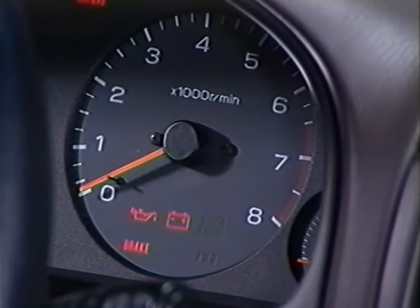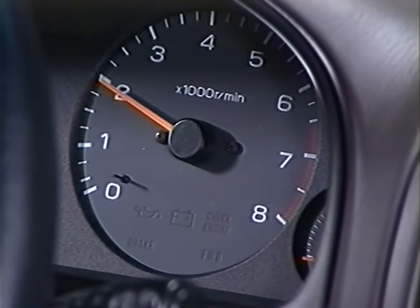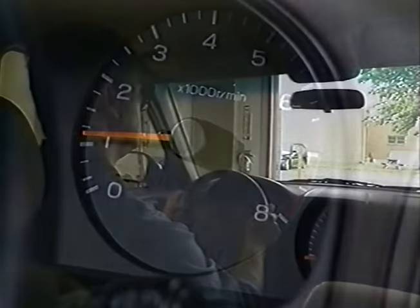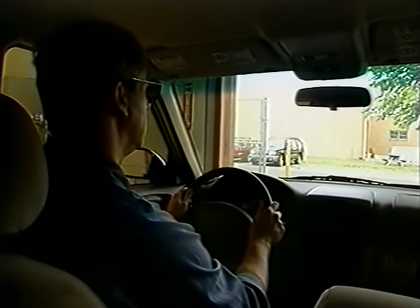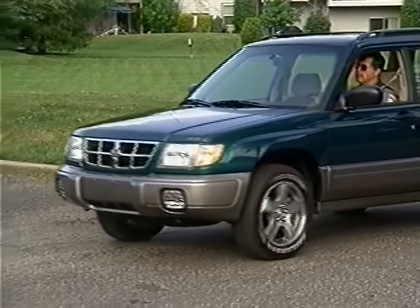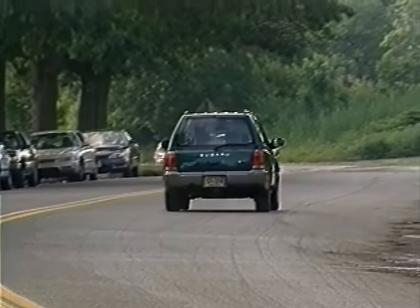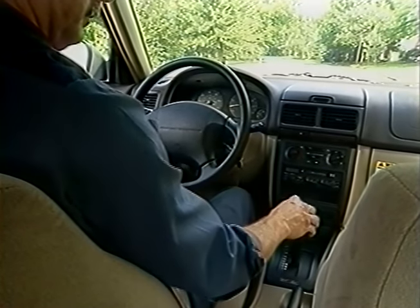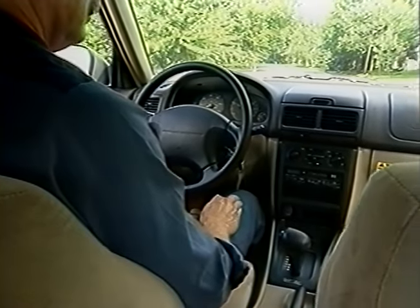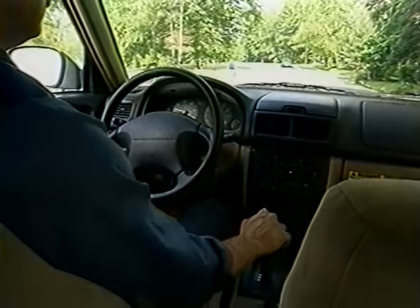Listen when you start the engine. Notice the cranking and cold idle speeds. Accelerate the engine and observe the tachometer. Verify that the warning indicator lamps go out when you release the parking brake. Turn on the radio and check reception of one AM station as you leave the service area, then turn the radio off. Check the engine performance in its different operating modes, including cranking, idling, and accelerating. Check that the transmission is performing properly with no slipping or binding. Listen as the transmission shifts through the gears — move the automatic transmission shift lever through all its drive positions and reverse to make sure the transmission is smooth.